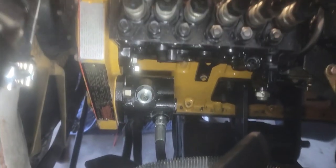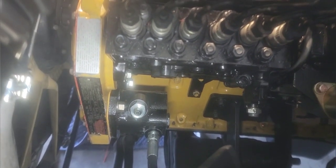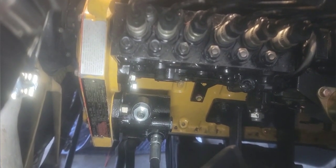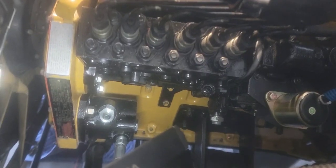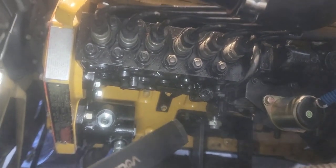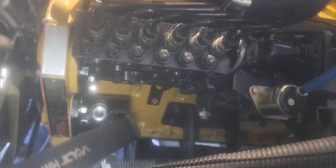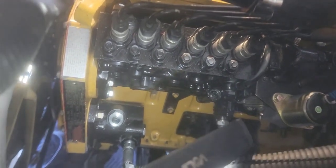The first thing I'm going to show you is I've got the hydraulic lines all in for the power steering. The silver one on the left there is the return line — that is a flare line coming back to the return. You can see that it is quite large and the fitting down there is quite small. I've got to get another reducer on that to bring it up to a larger size — or find one to take it down smaller — to get it looking a little more factory in here.